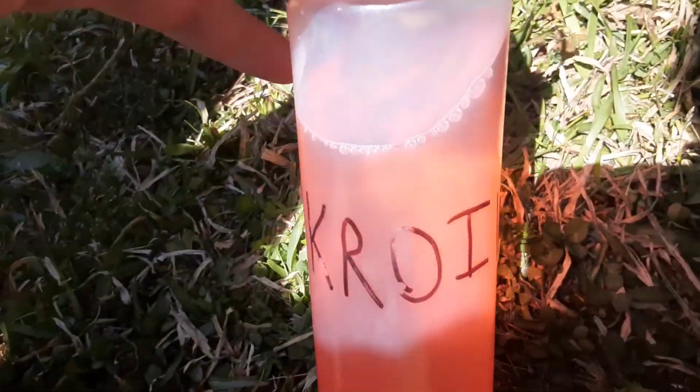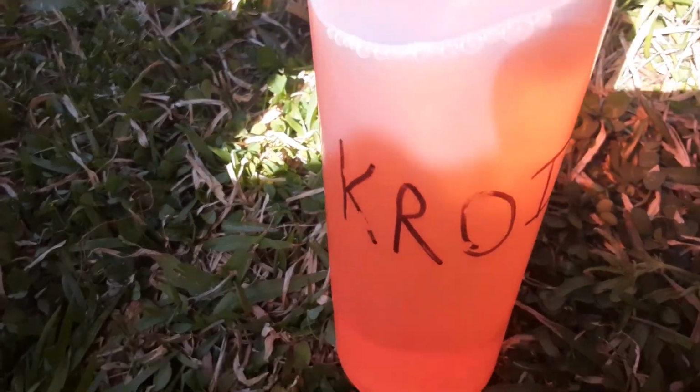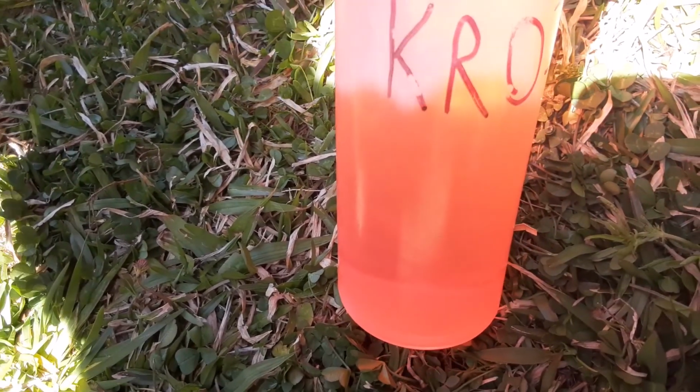Next thing I'm going to do is put some penetrating oil on, because this is on the other side of the car, and it's been sitting over the years. I use something called Kroil. This stuff's a little bit badder than the PB Blaster. It will dissolve rust. It really likes to penetrate and do some good stuff. So I'm going to try to get it on this bolt right here, the stud coming out of there.